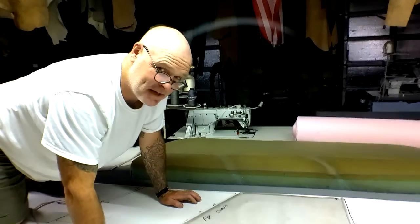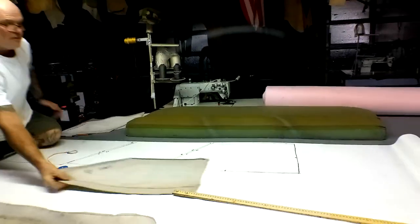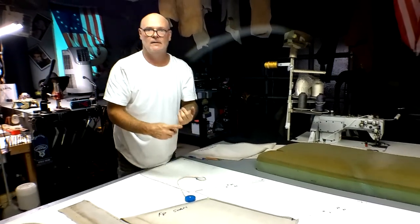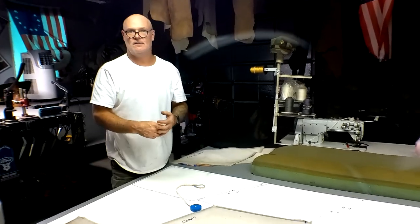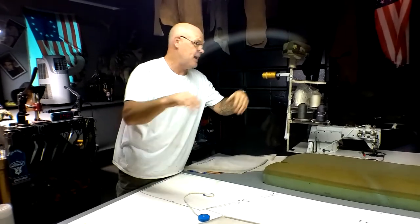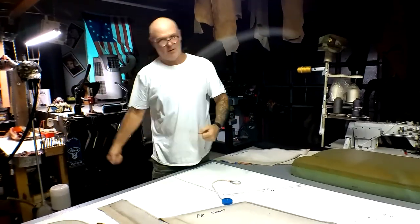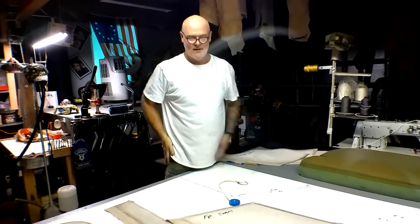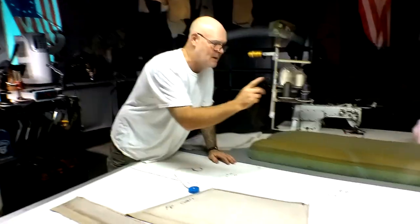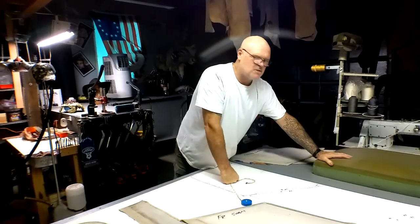So if you can't keep up, take some notes. All right, so that's what we're doing. And tracing, tearing a seat apart, pay attention. Where are the anchors? What are you looking at? Was it weird before you tore it apart? And then once you take the hide off, this is the hide, the original, the whole upholstery you take off of it. It's usually in one piece in most cases. Then you have to tear that apart, but you have to be mindful and remember, you want to avoid these things. You want to remedy and fix these things. And this will happen to you almost in every upholstery job that you do.